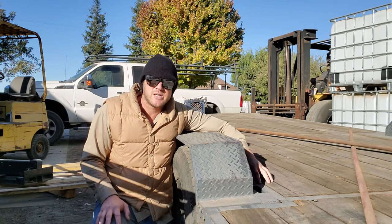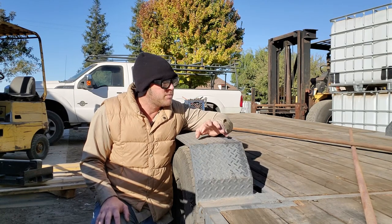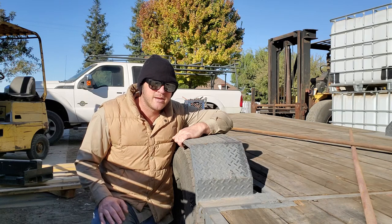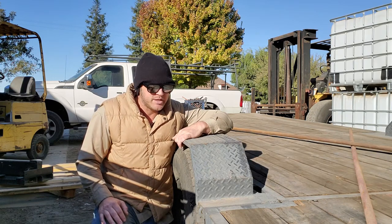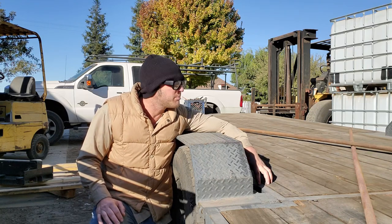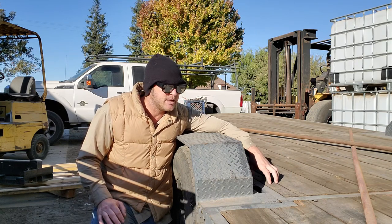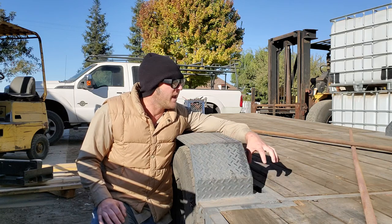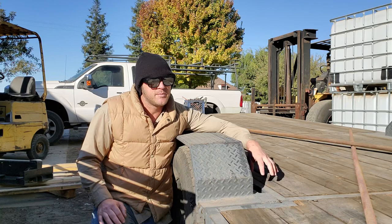Wood versus steel was another toss up. Personally, I prefer wood because I haul a lot of steel, and steel on steel can get really slick, especially during the winter months. Wood is a little bit cheaper outright, and if you keep it sealed, it does hold up pretty well. Since I originally did it, this has been sprayed once now with diesel, and it has been sprayed once with a regular oil-based sealer.